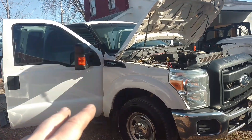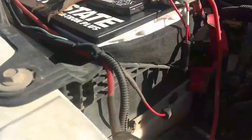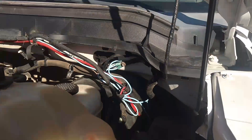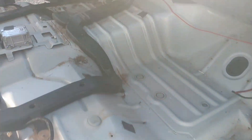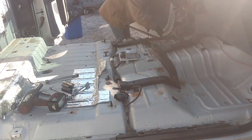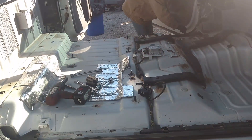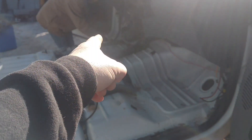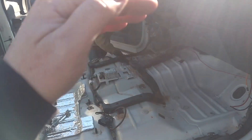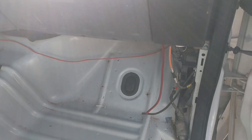Here's what we're going to do. This truck has tons and tons of aftermarket wiring on it — crap upon crap. The only way to get all this stuff out the way I want it out is to take the interior apart. Some of it runs underneath the carpet, which we've already pulled out. You can see my wife cleaning up the dirty mess from where crap gets down between the sill plate — pretty common occurrence on a super duty. It's wet, so if you've got a super duty, make sure you take that sill plate out every now and then and vacuum it out, because it holds dirt and moisture and will rot and get down into your rockers.